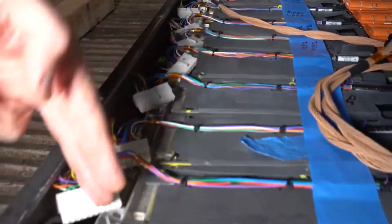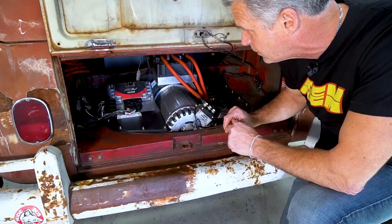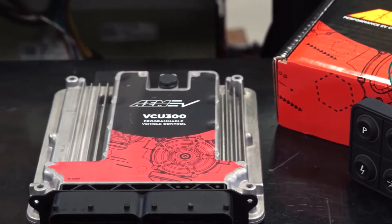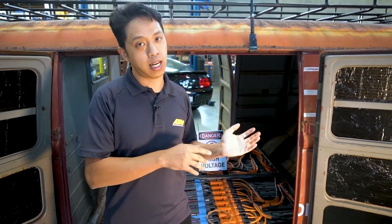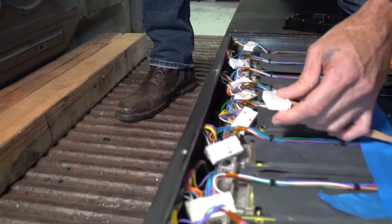This vehicle is equipped with chargers that are programmed specifically for it, so there's a specific charging curve — as the voltage comes up towards maximum capacity, the current the chargers deliver drops off to avoid overcharging. With our VCU monitoring the system, we can get away with just ramming the battery with as much charge current as the charger can supply. As it gets near the limit, the VCU will watch it, turn the charger off as needed, let the voltage sink back down, check it again, and if needed turn the charger back on — keep doing this until the battery is topped off. This allows us to reach maximum capacity in a shorter time, because that last 10% can take hours with a battery this big.